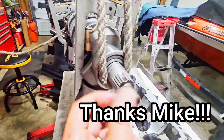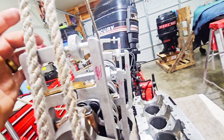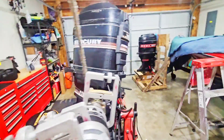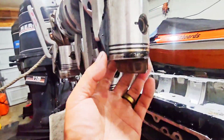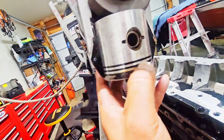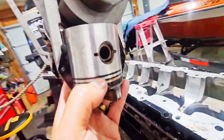You want to have your key facing straight up. The first three are screwing out, four and five are different — they actually screw that way, and then this one screws this way. As you can see, I have them numbered. When you put the compressors on, you want them as high as possible on that last ring, and make sure you get it right there on that pin that keeps the ring from spinning. That's on both sides — you have two on this side and one on the other.